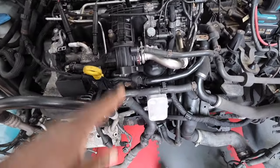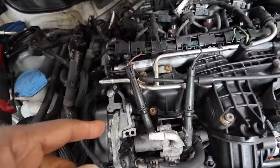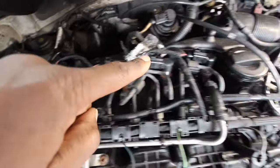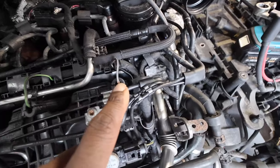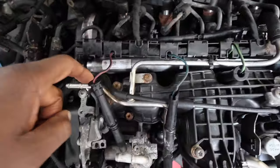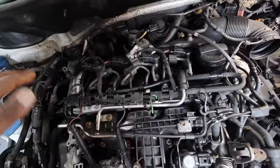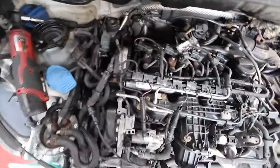We've stripped off all the inlet manifold pipework. We've taken off the fuel lines — one there and one there — and moved those to one side. We're now going to work on taking off the injector ignition system, take off all these lines, and remove the glow plugs — that's what the colour codes are for. There's a little cut on one wire there that will need repairing. Then we'll take off these vacuum lines and move them out of the way, undo the fuel regulator and fuel rail, which should give us a clear run to the injectors.